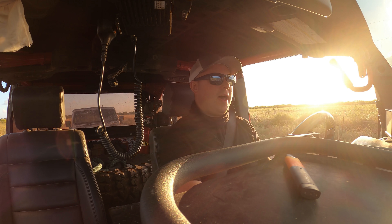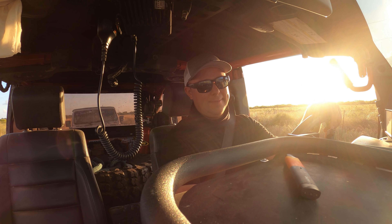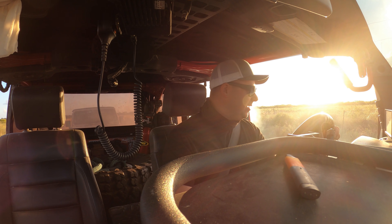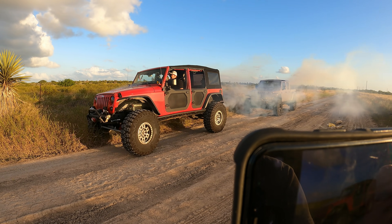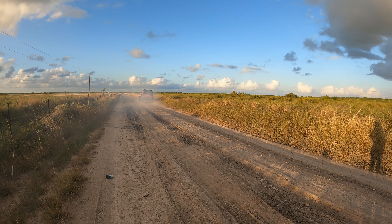It's going to stumble a little bit, not only on startup but when we first drive it, just getting all of that crap out. You definitely don't want to forget to hook up your brake booster. Give it a few revs. Let's drive out of here nice and hard. That is one of the reasons why you don't want to do it in your driveway or neighborhood. Part of the smoke coming out is just the seafoam burning off, and the other part is all of that carbon buildup burning out through the exhaust. Definitely a lot of smoke and it smells.